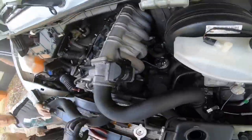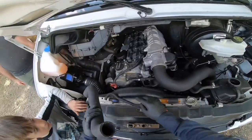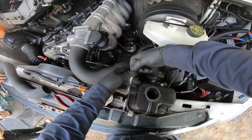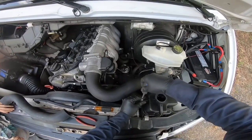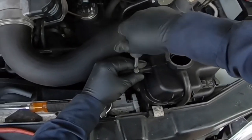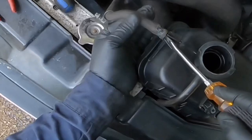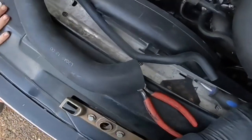We're going to be replacing this small hose and the larger hose back here. We can use either a small screwdriver or a big one — this is not difficult. Just be careful pulling these hoses off because it is a plastic type of fitting, and any of these plastic fittings could actually break off, especially the ones on the power steering pump. People have broken that plastic before. You can pry it a little bit with the screwdriver and then just pull it off.